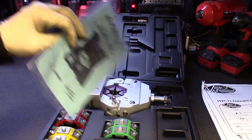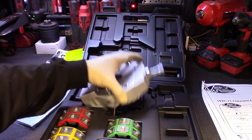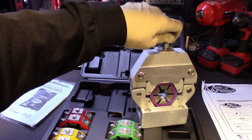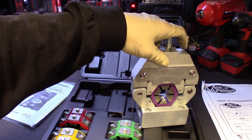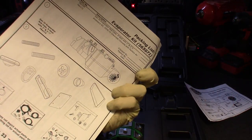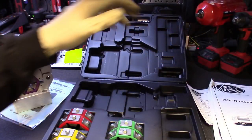Mostly for power steering the dies will be a lot smaller. These dies are numbered — you can see 8, 10, 12, and a 6 came loaded in there. Here's the apparatus used to squeeze down on the die evenly to get your nice grooves in, pretty much make it stock. You don't want to go too much or too loose — you just want to make sure it pinches that rubber inside the die. After reading through the instructions on this factory air installation, it looks like we'll probably be using die 6, 8, and 10. Die 12 we're not going to need today.